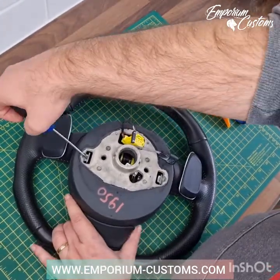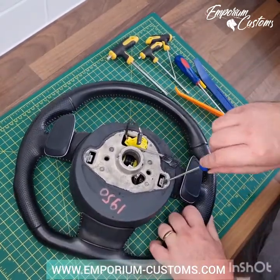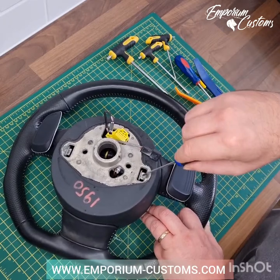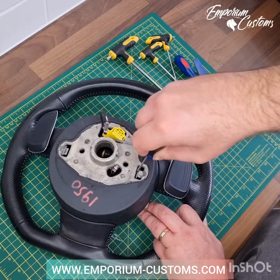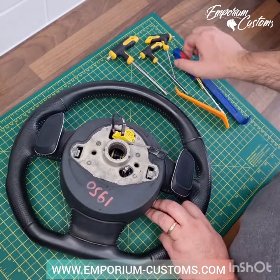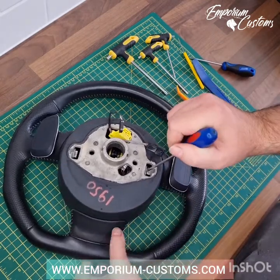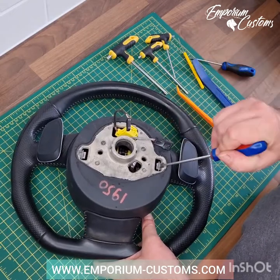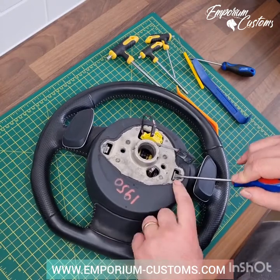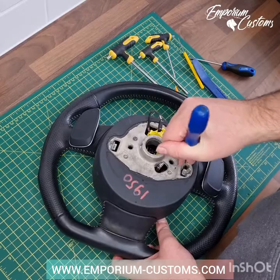You've got to do that both sides — even off the vehicle it's difficult because it's pinning back, so you've got to pull it forward at the same time. It's the same on this side: you've got to move that across and then be pulling it towards you. If it's never been off the car, it can be an absolute nightmare. You've got to get this spring clip the other side of this hooky bit and then pull it forwards. Oftentimes the screwdriver will get caught between the tab and the spring, wedging itself in there, and because there's not much room it's really difficult to lever it off.